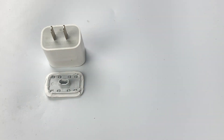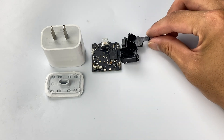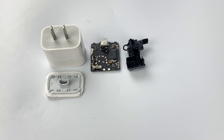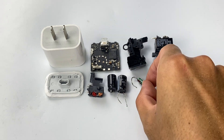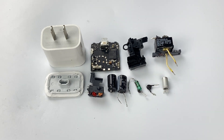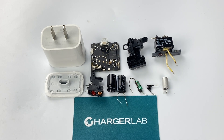We have to say the quality of Apple's power adapter is pretty good. It uses a master control chip from Power Integrations and a protocol chip from Infineon, and the capacitors are all from Japanese brands. However, there are still some disadvantages in terms of protocol — it only supports USB PD 2.0, and even Apple's own 2.4A protocol is blocked. So what do you think of this $19 charger? Will you buy it for your new iPhone? Leave your comments below, and if you like this video, drop a like and subscribe. See you next time.